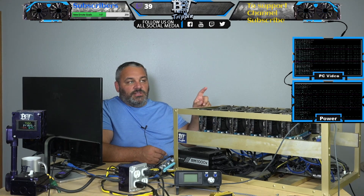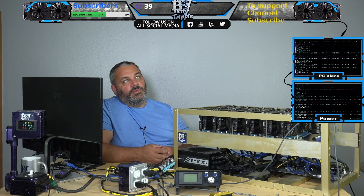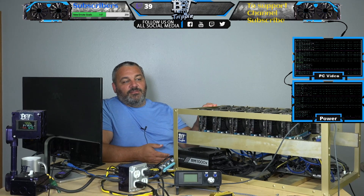It was still generating something like 0.013 BTC every day, so it would have taken about three months to make a single Bitcoin. When you do the math on that, four GPUs pulling about 580-600 watts for two of them — about 280W each — plus the machine at about 100 watts, it was about $160 to get a Bitcoin. So that's the cost-benefit at that time.